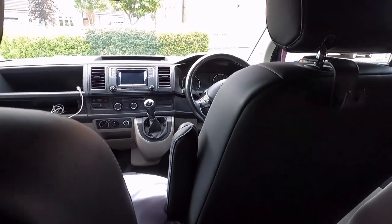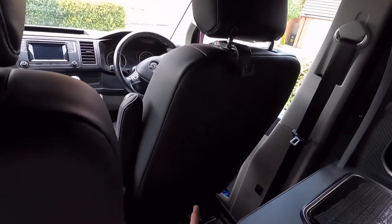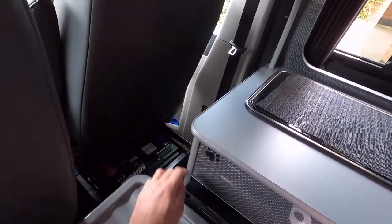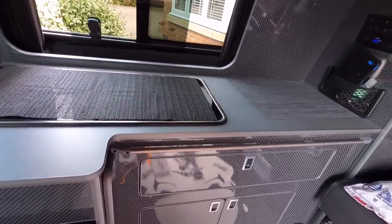Right, so I'm going to take the head unit out, drop the cables behind there round. I'll bring the left and right rears around that side, and then back behind this unit. Obviously once behind the unit, I'll secure them with those cable tie fasteners.